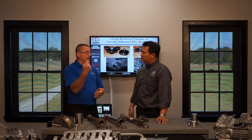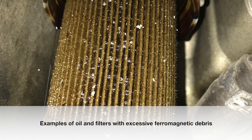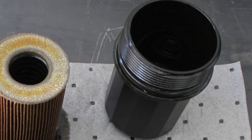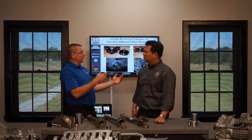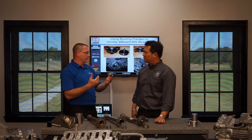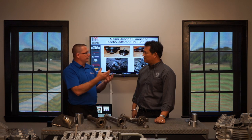When you drain the oil, see what's in it — get dirty, look at it, don't just dump it out. Pull the filter canister out, remove the filter, and cut the filter apart. We can share photos of cut-apart filters. Look in between the pleats — unfold it like an accordion — and see what's in there. Judge what you find on size, color, and quantity. How much is ferromagnetic, how much isn't? A refrigerator magnet will tell you that, and it will determine whether you have steel or alloy wear debris. Also look at the bottom of the filter canister — that's another window to the soul of the engine, because it collects a lot of debris by gravity and it stays there.